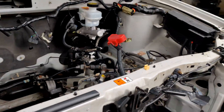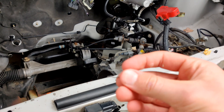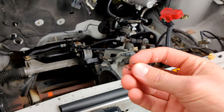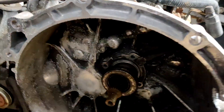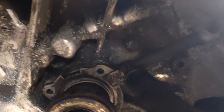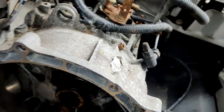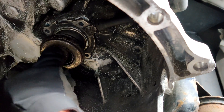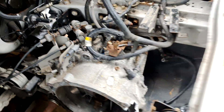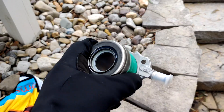What I just got out today was this tiny little retaining clip. This is what holds in the clutch line to the cylinder — you can see that little notch right in there. It's a pain to get out. But now I've got to take the old throwout bearing and clutch cylinder out and put the new one in. It might make a bit of a mess. Here's the new one.